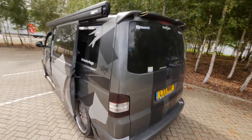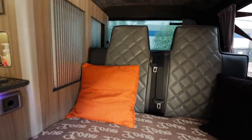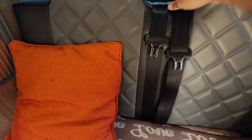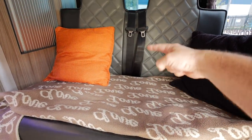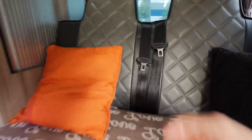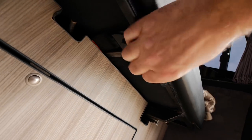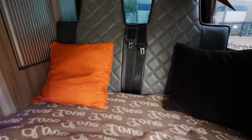It's quite hard shutting the tailgate now actually, because I changed the gas rams for the uprated ones for the bike rack - now I've taken the bike rack off, it's quite heavy to push down. Inside, I made quite a big change to the layout. This seat belt won't retract anymore, I need a new one. The old design had the seat belt mounting to a bar that went across - when I was pulling it, this part was coming forwards which made it awkward. So I've changed the design: the front portion is now mounted and welded directly into position, so as it pulls out everything comes out together, the length stays the same, and it all folds down nicely.